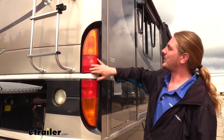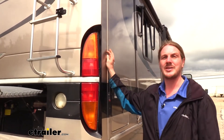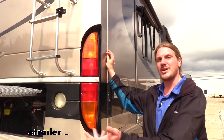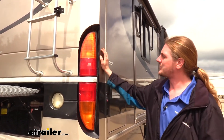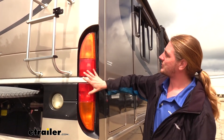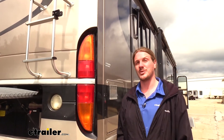The issue with having separate lights like this is that oftentimes at your seven-way connector down at the back of your motorhome the lighting is not going to work properly on whatever you're pulling behind it, because you'll have your left and right turn signals, but when you hit the brakes the brake signal sent back here is just illuminating these.